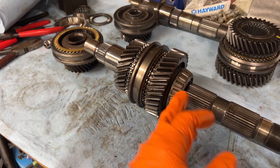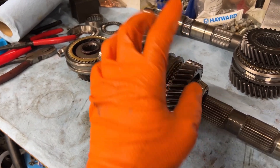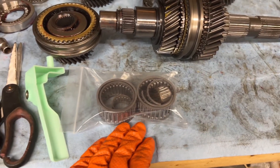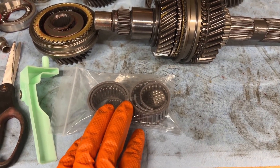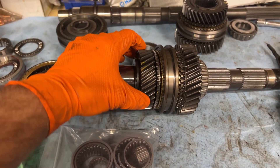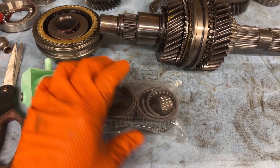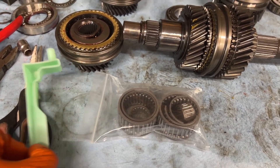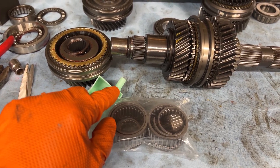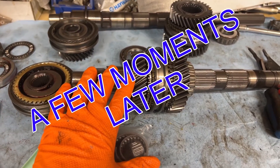Everything else from the three liter transmission I'm putting in. I'm going to press this bearing off — I've got a guillotine that I put on here and then put that in the press to take it off. Then let's get the new gears on and get this thing put back in. Also, one other thing I wanted to mention: the rebuild kit I list in the description didn't come with the needle bearings. There are quite a few needle bearings in here between all the gears and the main shaft, so I ordered those separately. And while I was at it I picked up a new one of these because there were little bits of metal in the old one — this was really cheap.